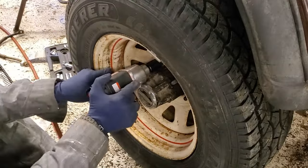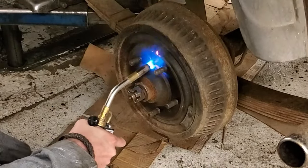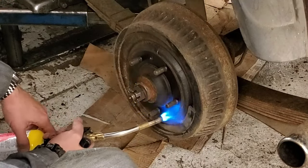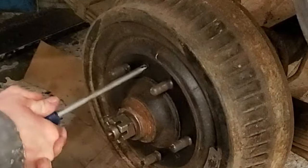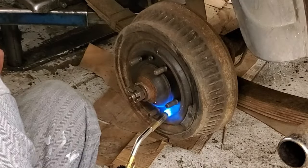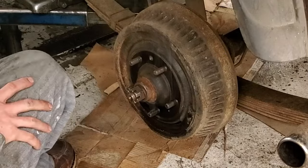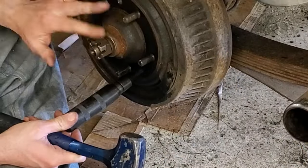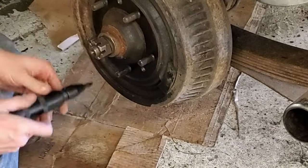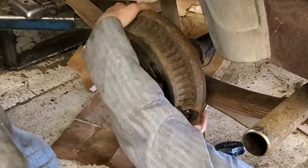I didn't show you the hour it took me to get all the rubber gaskets back onto the front brakes. It's not technically complicated, it's just difficult — you have to hold three things in place at the same time. The drums were held in place by three Phillips-head screws, which I understand are only there because they were used on the assembly line to keep the drums from falling off. I used a lot of fire, and also ice — heating it up with the MAP torch and then hitting it with upside-down compressed air, which shoots out basically liquid nitrogen. The contrast of heat and cold was enough to eventually get those screws to free up. All the stuff I read online says you don't have to put those screws back, but I went ahead and did it with a lot of anti-seize on them too, so hopefully the next time somebody pulls these drums off they won't have that problem.